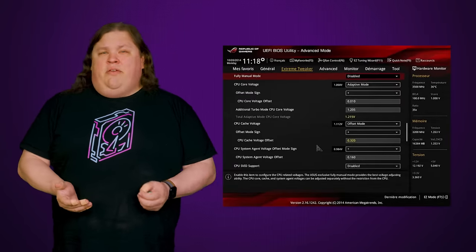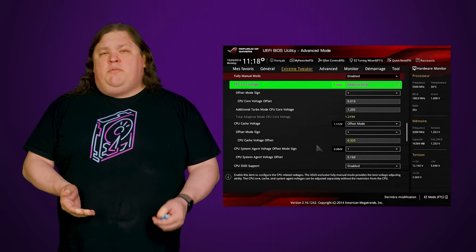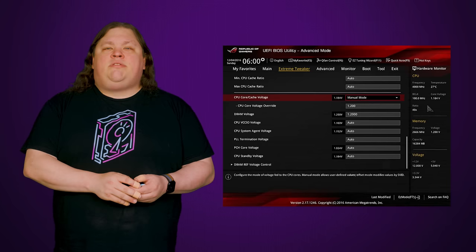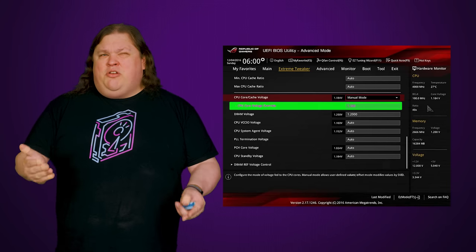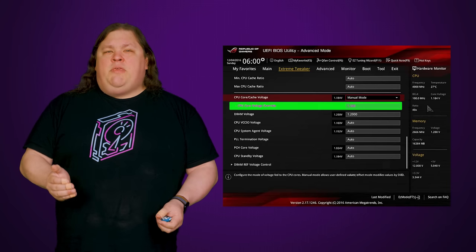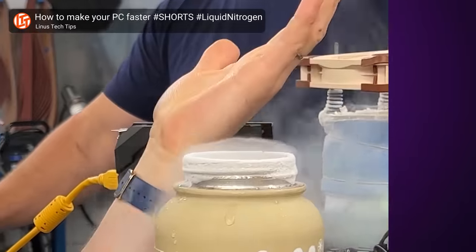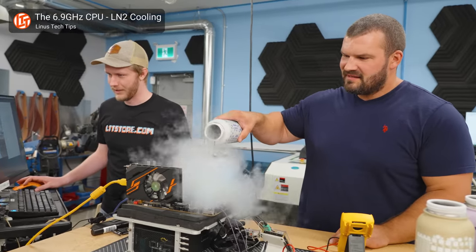Using an offset or adaptive mode will only push your CPU up to that maximum voltage when you enter a load. However, make sure you stay away from the override setting unless you know what you're doing, because that will run your CPU at whatever voltage you set all the time. That's there for folks into competitive overclocking or chasing records — probably don't use it for daily driving unless you really don't care what happens to your processor or the rest of your system.